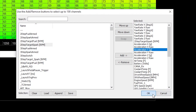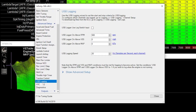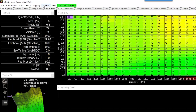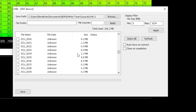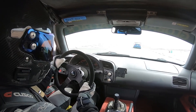Now that that's all set up and confirmed, press OK. We'll also jump into the wizard to show you where the USB logging setup is. Under Advanced Setup, we have our USB logging section. This car is going to log every channel at 20 hertz anytime the vehicle is over 500 RPM — as long as the car is running, we're recording a log. Dustin has logs already saved from the track at Willow Springs a couple of weeks ago. To download the logs, go into Logging, USB Logging, Get Logs. We'll find the ones from the track, select them, save all those, and then open them in AEM Data to take a look at what we've got.